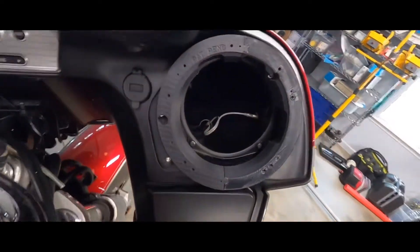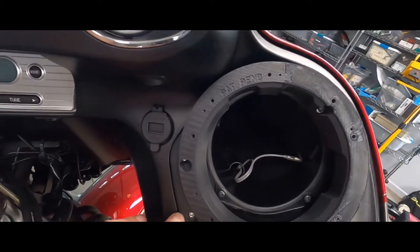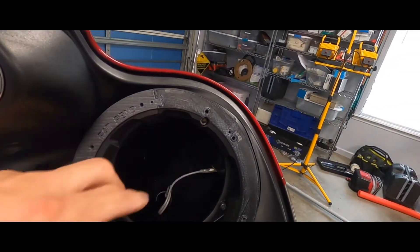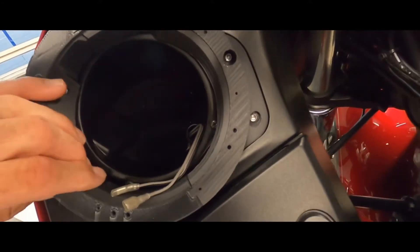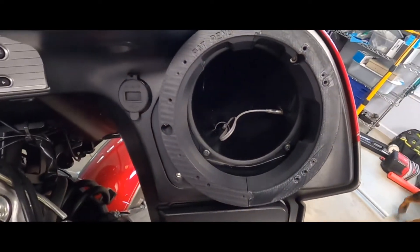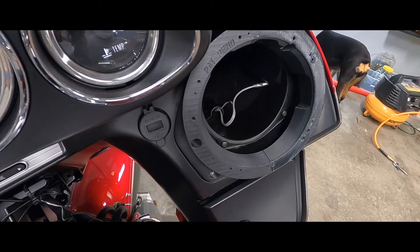What wasn't perfect is the way this lines up — there's definitely some molding. Obviously it's patent pending, it's an aftermarket fit, not a factory part, so it didn't fit absolutely perfect. It took a little modification. I started the top bolt and had to push and pull to get it in place, to where it actually dropped down in the groove. When I first put it in it was sitting on top of the cowl, not down in the groove like it's supposed to be. Same on this side — it took a little maneuvering. I snugged them up before tightening down, starting at the top and pulling it into place with the two lower bolts.